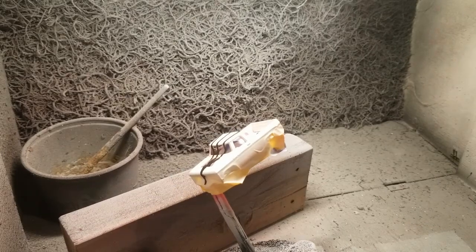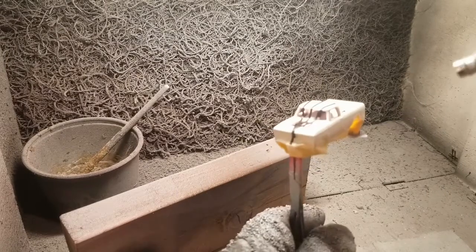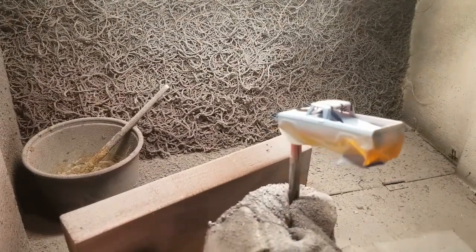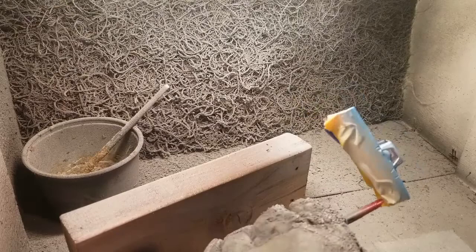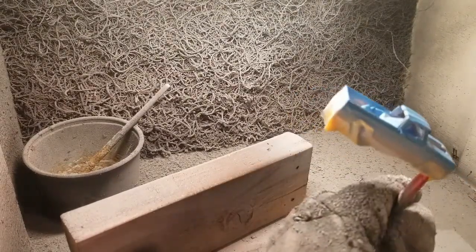But first coat here, pearl blue coming up. We're going to lay it on nice and light, a little tack coat. Just get good coverage all over, front and back, side to side. And then we're going to let this dry for 5 to 10 minutes and come back and start layering on.